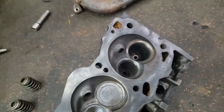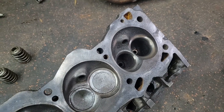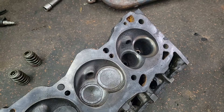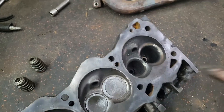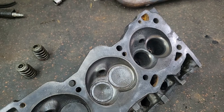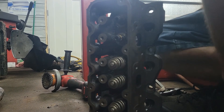Look at that — the surface is much better now. You want a good surface for when your valves open and close. These don't need to be resurfaced or reground — they're fine, they're not pitted up. Most times if you see valves really pitted up then you'd want to do that, but the surface looks really good and uniform. This is good enough — I'm just cleaning it up. This is for my convertible.